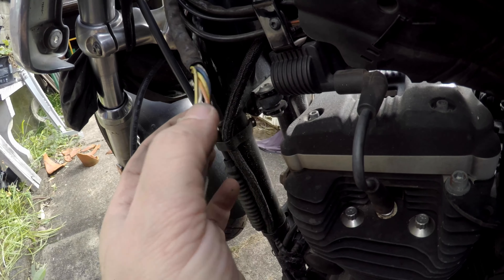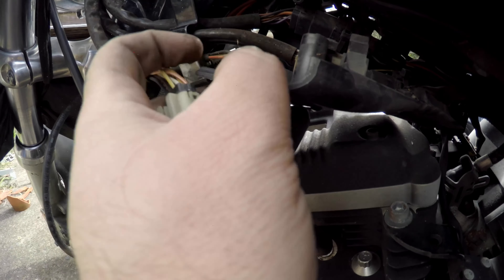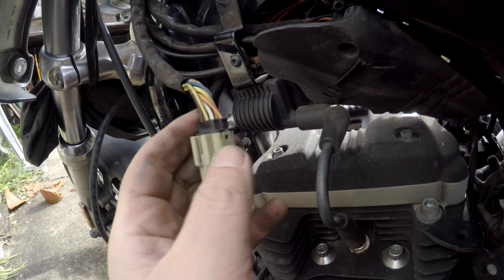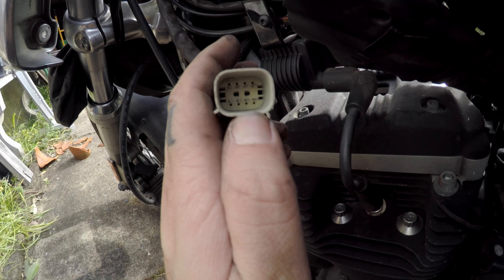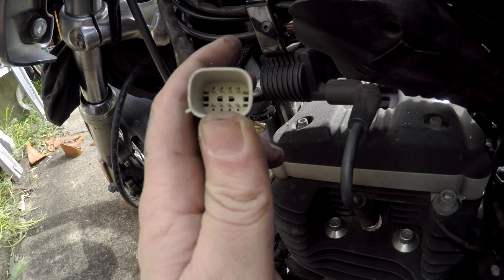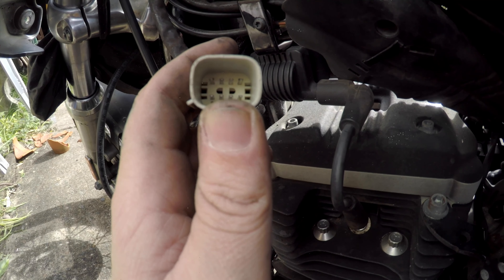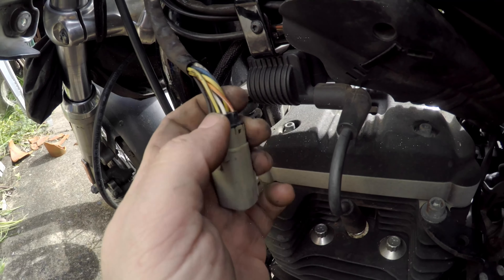I've successfully unplugged the left-hand side control switches down here under the petrol tank. You just remove this flap here and you basically get access to both sides, left and right. The next part - the daunting part - we're going to have to remove all of these wires. You don't cut them. If you look down the plug, there's a top and bottom row of pins, and above the top and below the bottom row near my thumb you can see those round little circles - they're holes, and you stick a pin in there, like a small paperclip, and it will release the wires from the switch.